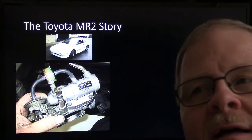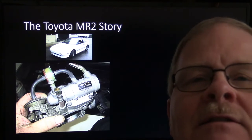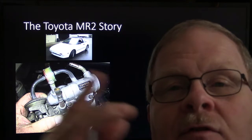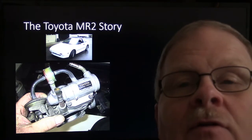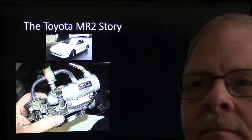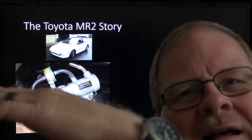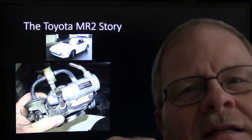I had to actually bypass the fuel pump connections on the vane airflow sensor so that the fuel pump would run, so that I could start it and then run it with the airflow sensor out of the loop where I could have the throttle body open while I was doing it. And when I covered that up, it would idle too high and stay up there too long, and when it finally did start to warm up, it would hunt and just all this kind of stuff.